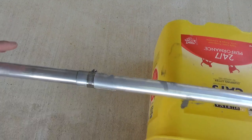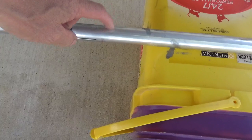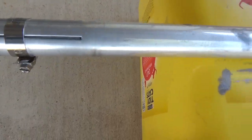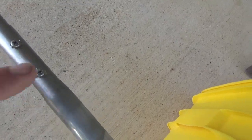I've got everything lubed up here. I've got this one inserted two and three quarters of an inch into this one — you can almost see where it stops right there. You have a washer and then a bolt that comes in the kit, so you want to make sure you put the little tooth washer right there. I wiped down the aluminum coating and I've got the aluminum anti-seize in here so that'll keep it from corroding.